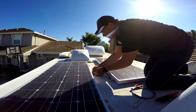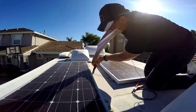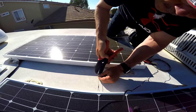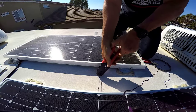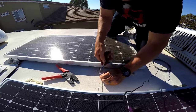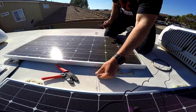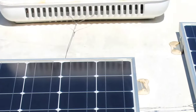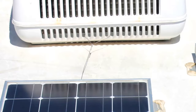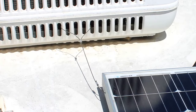To attach both solar panels together I cut the amount of cable needed. After feeding the cable through the first hole I inserted the ferrule onto both cables, placed it close to the panel, and crimped it. After securing the other side I cut off the excess cable. I did the same process to the air conditioning cover and in front of the solar panel. Now both panels are tethered together and to the air conditioning cover.